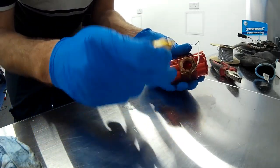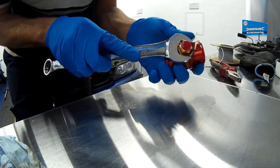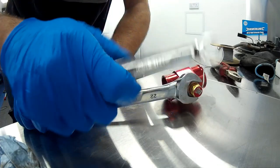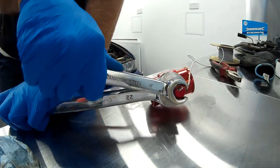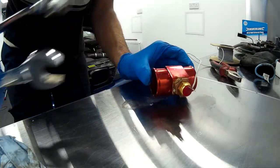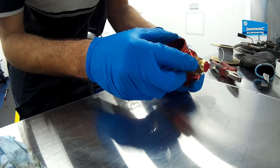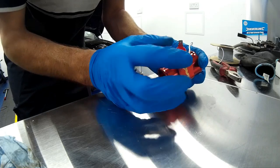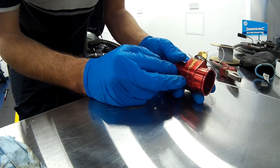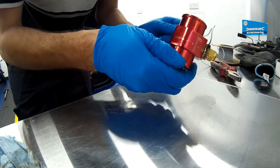Now we're going to fit the sensor — screw the sensor straight into the bushing, nip it down by hand. Once done by hand, hold the bushing with your 22mm spanner then tighten the sensor up with your 17mm spanner. The sensor is a tapered fit into the bushing so it should be self-sealing. You don't want to tighten it too much — tighten it enough so it's sealed but don't strip the threads, and don't start moving the bushing in the housing because that will break the seal. So that is now ready to fit on the car. What should have been a simple take-it-out-of-the-box job as always with eBay and Amazon turns into a marathon job — but it's ready to go.